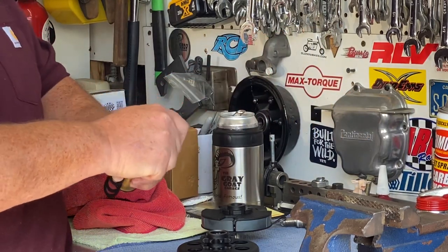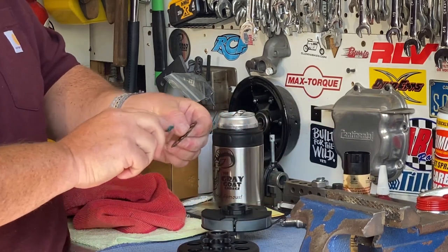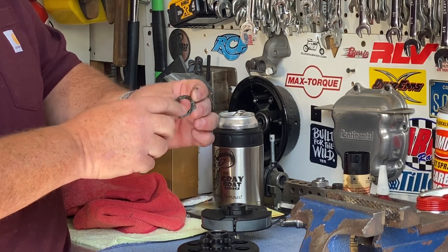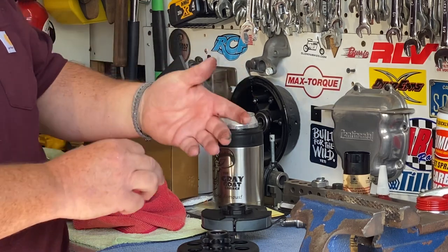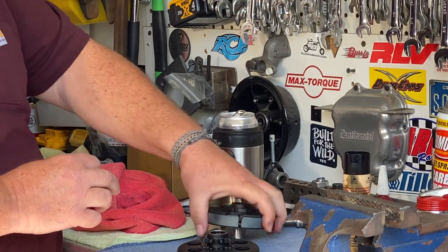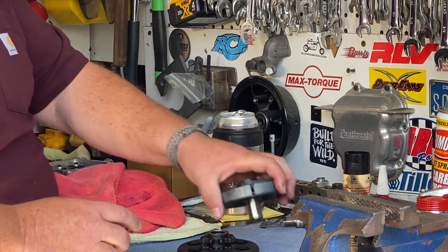What I'm going to use is just regular wheel bearing grease. I'm going to take a little bit of grease. These act as thrust washers inside, and if they bind up, your clutch is not going to spin free. Make sure not to get any grease onto the shoes, and then just reinstall these — just let them sit right there.